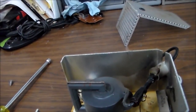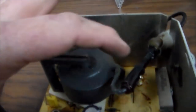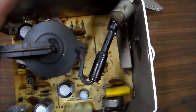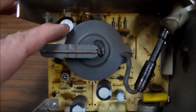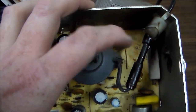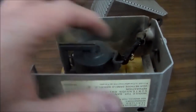When something's blooming like that — when the picture gets bigger — you may not have seen it, but when it first started it was about right and then it just got real big and stayed real big. That often has to do with this high voltage diode. As you can see it's in there kind of crooked, so I don't know if that's been repaired at some point or if they put a new one in, but if that's not making good contact it'll do that — it'll make the screen really big. So I'm going to replace those three caps, test the diodes, and try to take this apart and clean it.